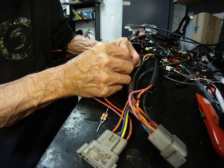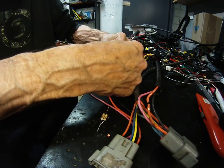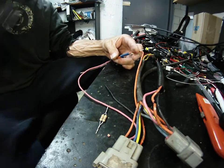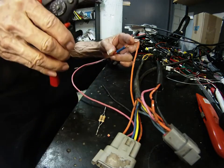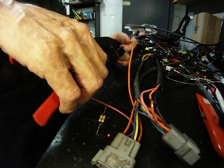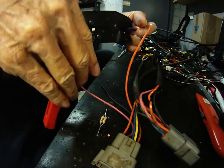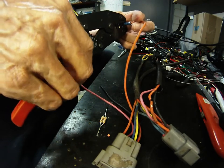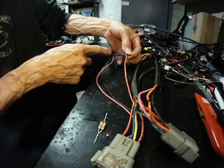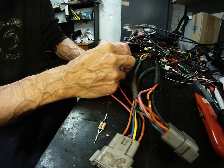The cable is fully ended and the resistors are in. Alright — that's the power side. Give it a squash with proper ratchet crimpers — they force you to go all the way down. Now, there's our centre point of our bridge, there's positive power, and our resistors which make 5k — two 10k ones in parallel.